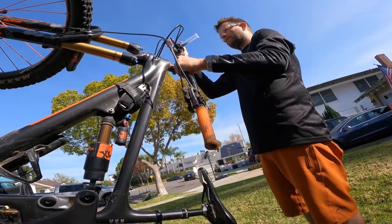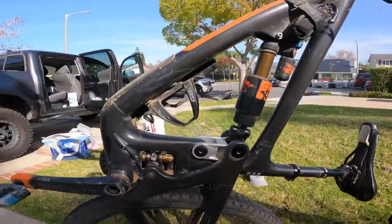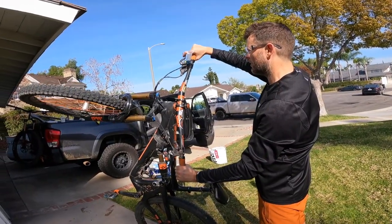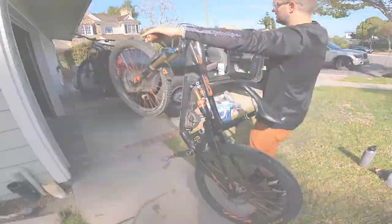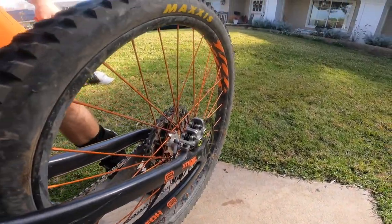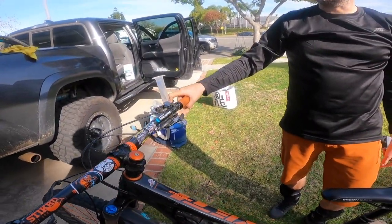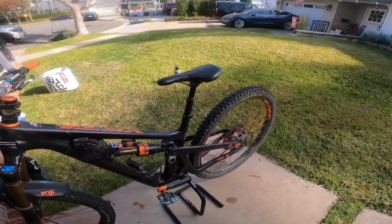Your lever is feeling really firm, so I don't think there's any air down there. The problem was mostly air up here. Haven't gotten bubbles in some time, so we're pretty much done. And look at the lever — bam, it engages like snappy. That definitely wasn't like that yesterday after the crash.